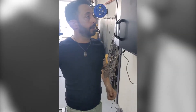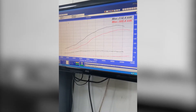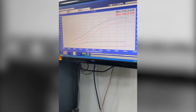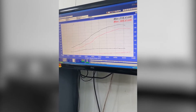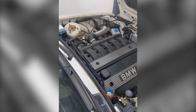One other technical consideration for those interested: we've nearly doubled the boost but we're not really seeing the proportional increase in power. The reason is this is still the standard compression naturally aspirated engine with minimal mods. With 98 octane fuel, we are limited as to how much power we can gain with additional boost. This car is going next on E85, where we would see even bigger gains — and even at this five psi versus ten psi, it is doing exactly what you'd expect.